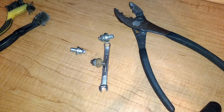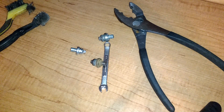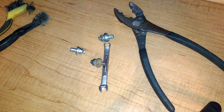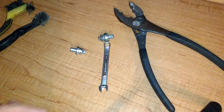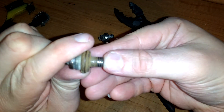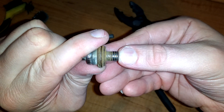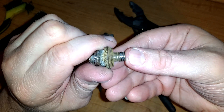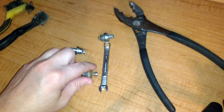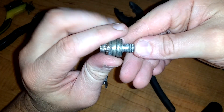I did feel that the positive cable was not quite as tight as it should be. I kind of noticed it when I put the new battery in there — it didn't feel that great when I was trying to tighten it, like it was trying to strip. What it ended up being was this old battery bolt that's only partially threaded, so you can only get a few threads in there and it doesn't thread all the way like it should, and it's got a little bit of wear on it. Not exactly a great idea to have something that's not fully threaded when you're trying to connect to a battery to get a good connection.